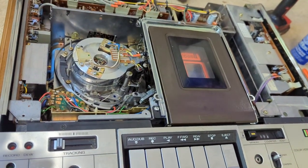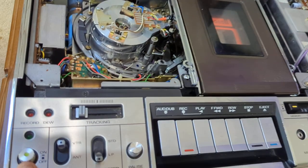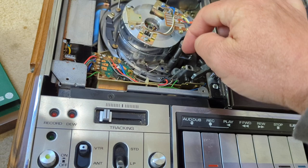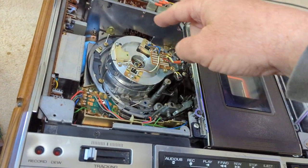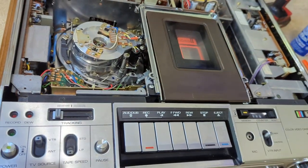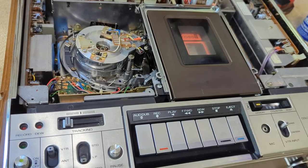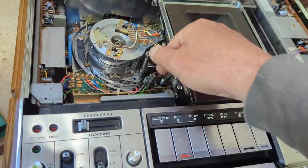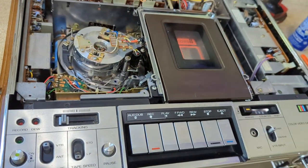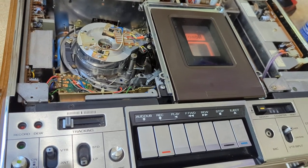I had some plastic gears, and at first when I turned it on the plate didn't want to go — it was sort of frozen up. I found out through trial and error that this plate goes around and brings the tape onto the tape head, and after a few attempts I just did it manually with my hand and it came unfrozen. The little guide rail down there I lubed a little bit. There's not a whole lot of information on the internet so you kind of just have to figure it out.